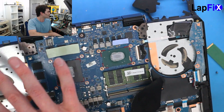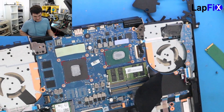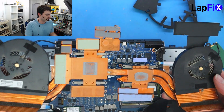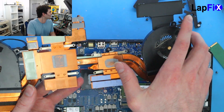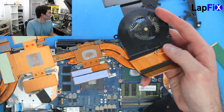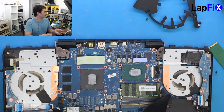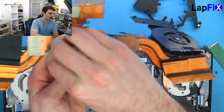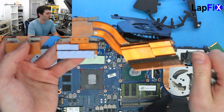So we're just going to scrub and clean this, then put some new thermal paste on, and clean the fans here. The fans are important — you can just blow through them if you have a little duster or a blow duster. Always remove the thermal paste on the heat sink too. You can always get dust in here as well, so make sure we clean that. You can do it as clean as you can — it looks pretty good. You can always put a little bit of alcohol if there's a little too much residue, but this isn't too bad, so I'm not too worried about it.